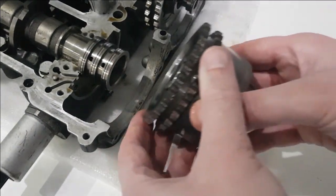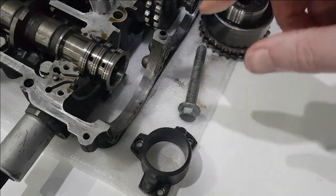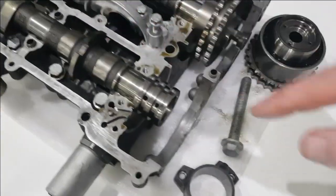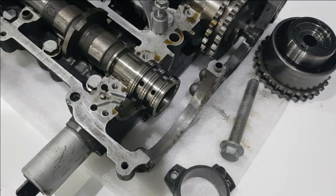So it's all a low pressure system just using the engine oil pressure. The position of the camshaft is picked up using this sensor here — there's a sensor which goes in through the camshaft cover to give feedback to the engine control system.